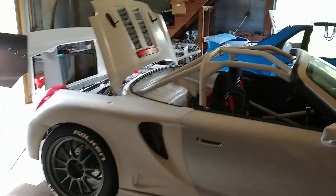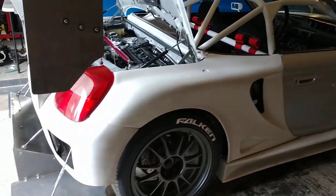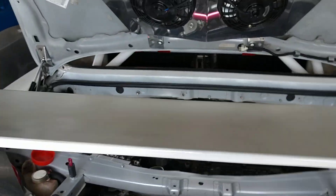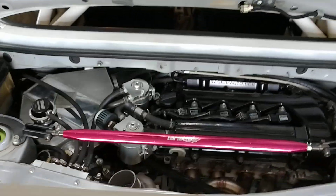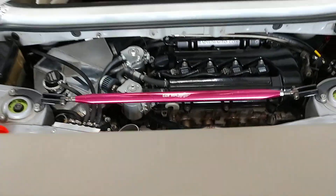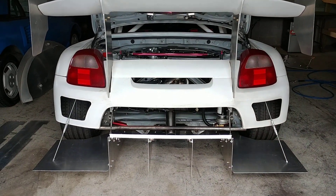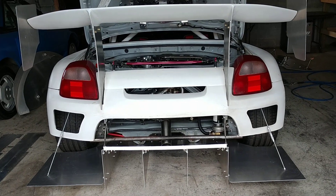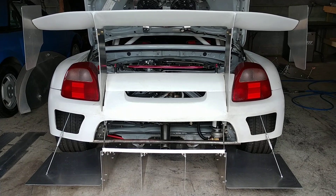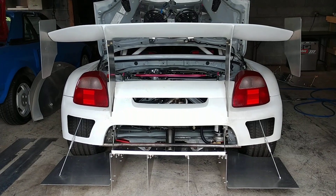I really shouldn't see a cap beyond what my engine is built for — the engine is probably good for about 550 and everything else is good for about 600, so we're not going to push that much power next time at the dyno. It's just going to be about getting the setup running on everything that's new and then learning how to tune it and moving from there. I'm still on a relatively stock transmission and really need to beef that up before doing anything too crazy. I've thought about running about two more psi on the next dyno just for fun, but we'll see.